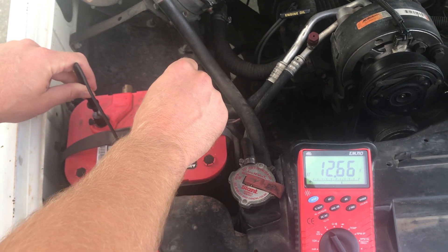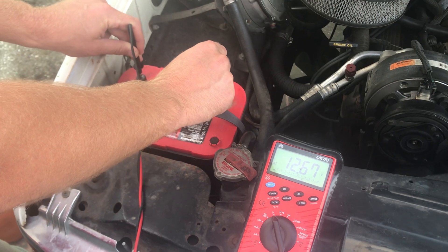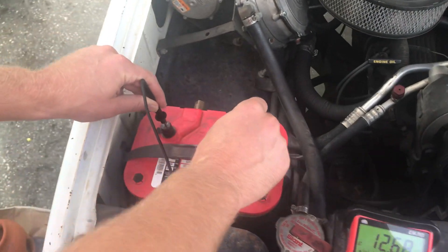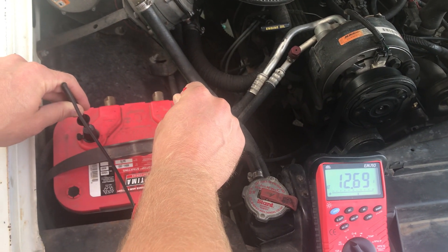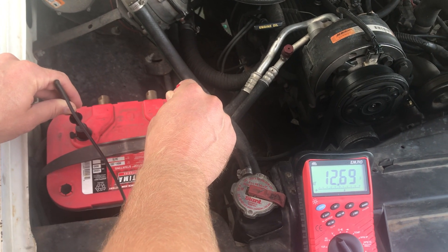So the best way to get a good measurement of battery voltage is at the terminals, not inside the vehicle. There could be voltage drop depending on the gauge of cable. And with a voltmeter right here, you can see it measures in at somewhere between 12.6 to 12.8 volts, not the 12.9 that it showed when it came off the charger.